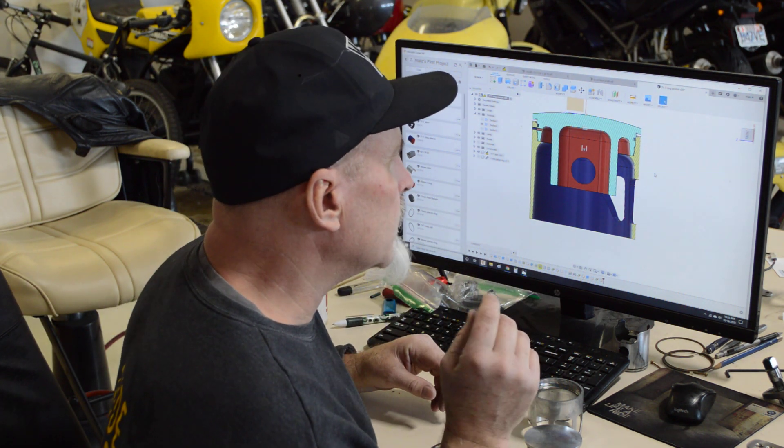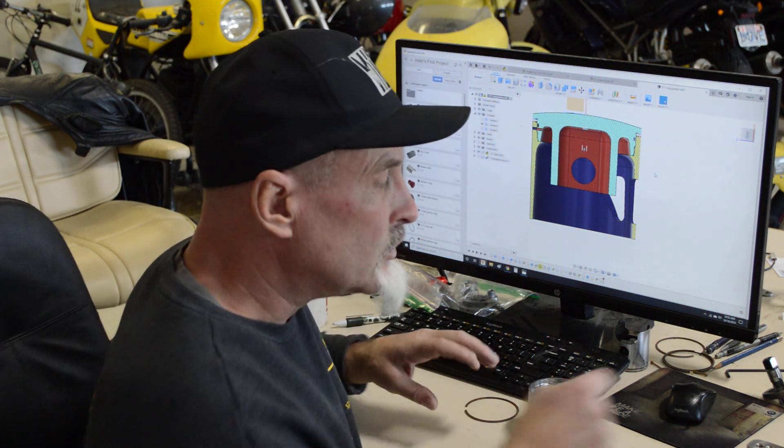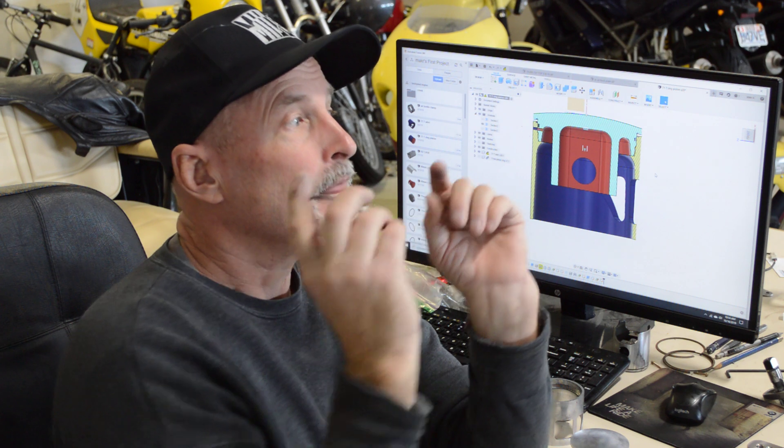In the meantime, I'm racing at El Mirage. The pinned standard ring situation I have is obviously not going to work — it'll work for a little while, but the fretting will eventually move that ring and it's going to catch a port, and that'll be a disaster. Luckily, like the problem I had before not getting the trapped rings back from the chrome plater — I've got them now. So I'm going to finish them and put those in the engine with the two pistons I have.